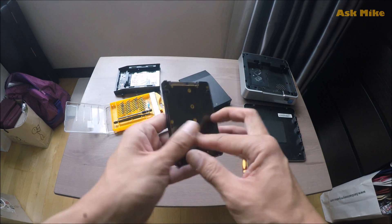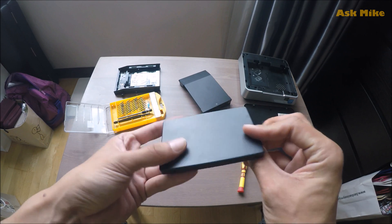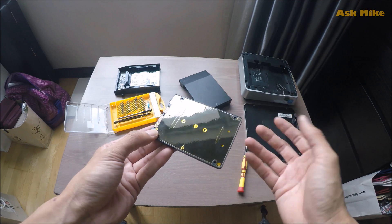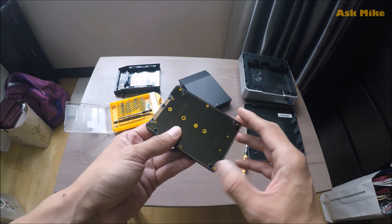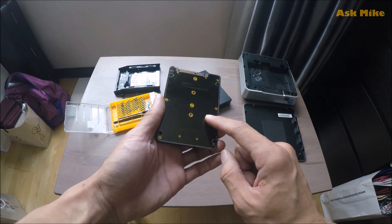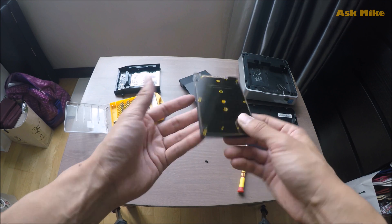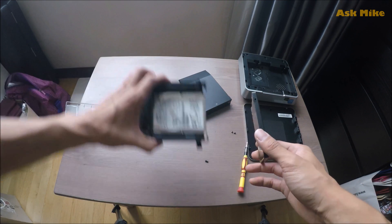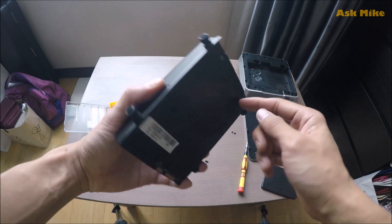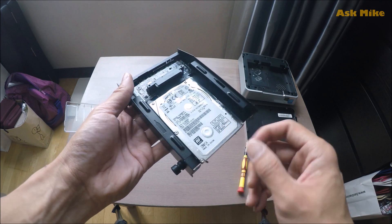So this is the drive being used. You can use a normal 2.5-inch SATA drive, or you can buy one of these adapter cases if you have an extra M.2 SSD lying around. I'll leave a link below to where I bought it — it's not expensive. The old HDD which is here has been screwed back, so what you need to do is just format it so you can use it as a backup drive.